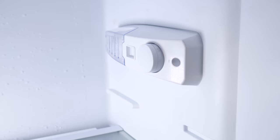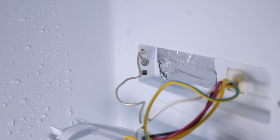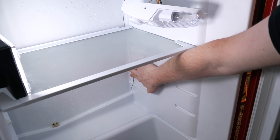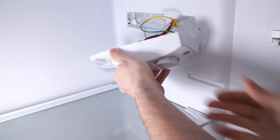Through the gargantuan effort of removing a single screw, I finally discovered that the thermostat has a remote sensing bulb. In other words, the dial may be here, but the temperature sensing bit is somewhere else. It's shoved within the walls of the fridge and going down, but I didn't know how far down it went. So I yanked it out. Turns out, it went quite far down. The sensing bulb ends up sitting somewhere around here, though without cutting away at the walls I can't know for sure. This felt pretty silly to me — why take such an indirect measurement? The point of a fridge is to keep its insides at a certain temperature, and somewhere inside the walls of the fridge is not quite the same as the inside that actually matters.